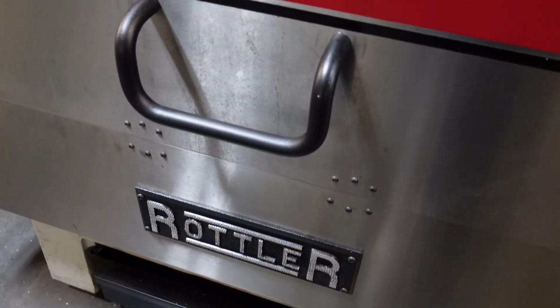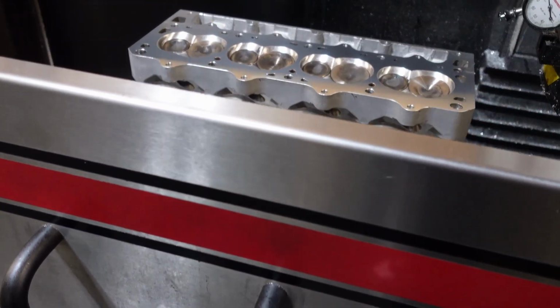Well, we just made it out to Tim's shop, Patriot Performance in Williamson, Georgia. We're here to do one thing that everybody skips, one thing that needs to be done when you rebuild a transmission, but not a lot of people have the resources, so everybody skips it, but it could destroy your dog box if you don't do it. You gotta come to a machine shop and get your gears checked for micro cracks.